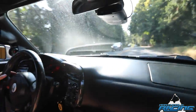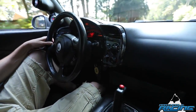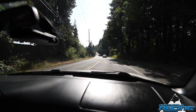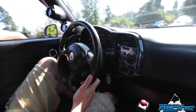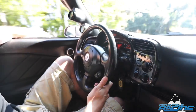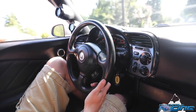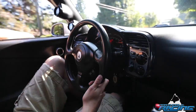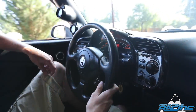Yeah, it comes up on stop real nice too. This thing does drive like a Cadillac — super easy to drive. We ended up putting a PTC converter in it. Big shout out to Dusty Bradford, he's the one that spec'd out the converter. It's one of their fancy converters — it's got a mechanical diode in it. Pretty high stall, because obviously it's a small 4-cylinder.